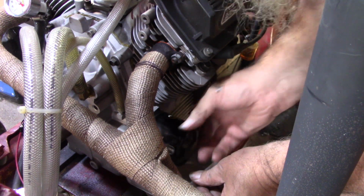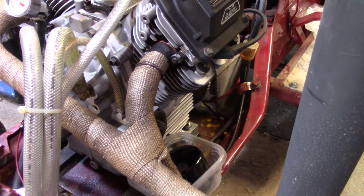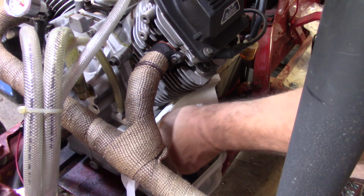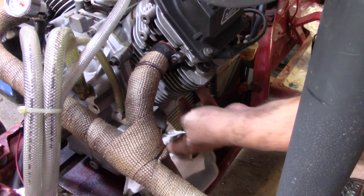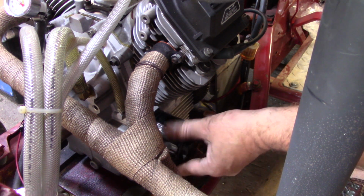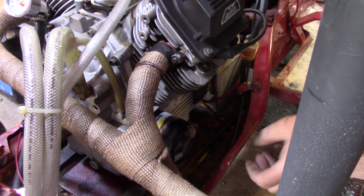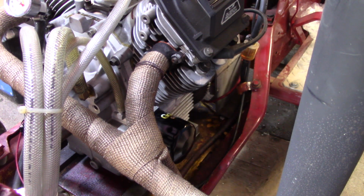Make sure that the gasket comes with it. Ooh. So I'm gonna grab a rag, new filter, and wipe that off, and we'll get the new filter put on. There you go. I'm gonna wipe that base off there where that goes in, wipe the underside off where it drips. Set that down there. Got my new Napa Gold, not a sponsor, oil filter. It is a 1056 standard size oil filter for all your Kohler engines, your Kohler Commands. So there it is. Got the oil all changed, got the carburetor all cleaned up, ready to go. Let me back you guys up just a hair, and we'll test fire this thing again.